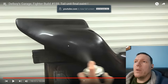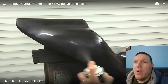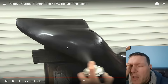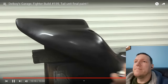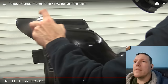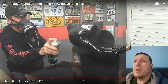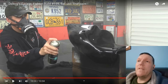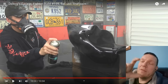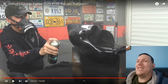Because what he's spraying on is bloated up. When all them solvents flash off, it shrinks. But not only that, these paint layers are nothing. They're measured in tens of microns maximum. All them layers will be 100 microns max together. That's a tenth of a millimetre. And if his little bit of dirt is 200 microns tall, then you're still going to see it, it's going to stick out.